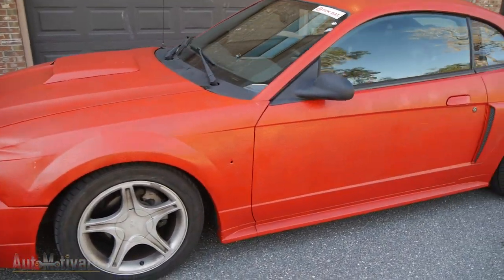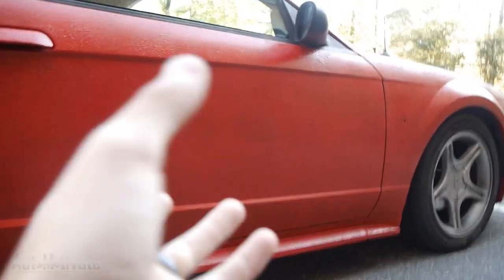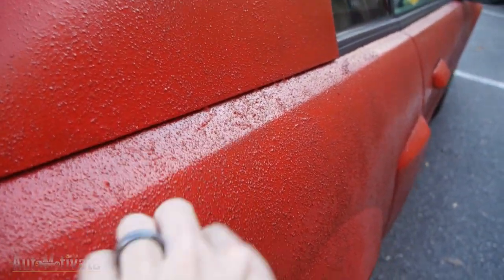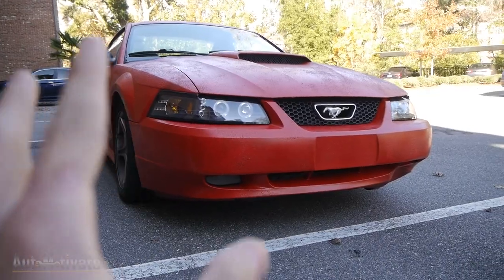Here's a quick walk around. It's a very vibrant red and it really pops, and that's what I was trying to go for. There is a bit of blotchiness — it's not bad, not too noticeable, but in pure daylight it kind of shows. That's basically the black beads within the bed liner popping out. If you're wanting to avoid blotching when doing this at home, make sure you mix the paint thoroughly each and every time you get fresh paint on the roller — that will make a big difference. It's very scratch resistant, durable and heavy duty, and that's what I was going for. It's been about two weeks since it was painted, so this is basically what it's going to look like long-term, and it looks awesome.